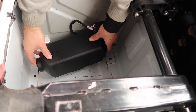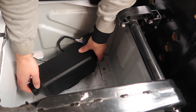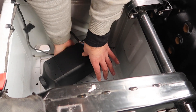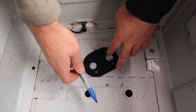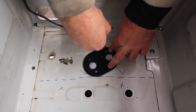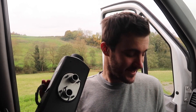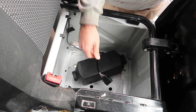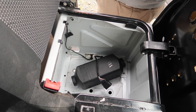I think an angle like we had it made more sense — I felt like there was more room for the intake to get air. What I'm going to do is just hold it in place with one hand and then push the rubber gasket down, and I'll use that as a template before drilling the holes. Perfect! So now I've drilled the holes and filed them. We just want to double check that the heater fits in the hole. Now we need to take it back out, paint the holes so they don't rust and then we can bolt it in there.